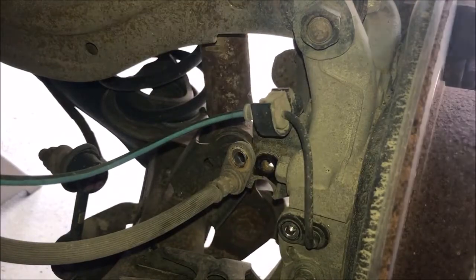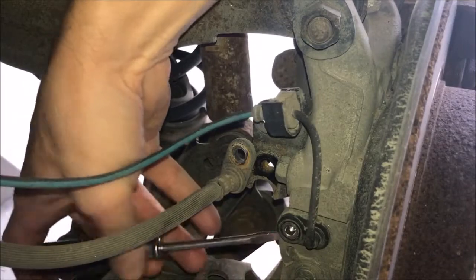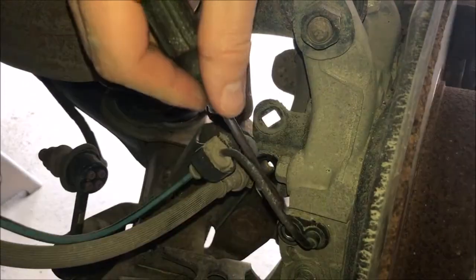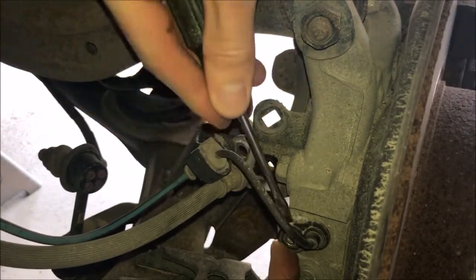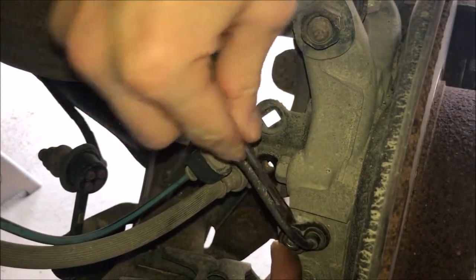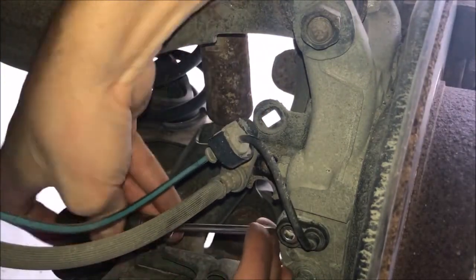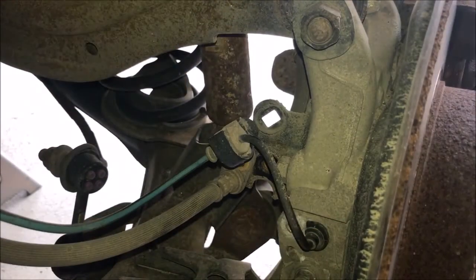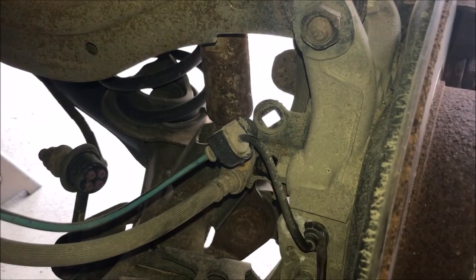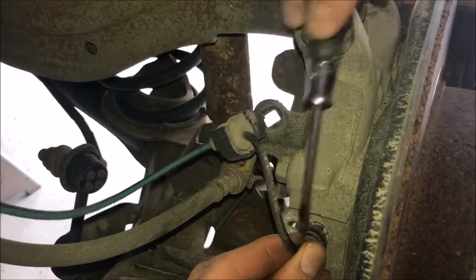These can be hard to remove sometimes and you'll see I made a mistake when trying to remove mine. If you're not able to get a screwdriver underneath, try moving the sensor back and forth, up and down, just to loosen it a little bit. As you can see, we're starting to get some movement, but I got a little impatient and applied too much pressure to the plastic tab and as a result broke it. Just take your time if it's giving you resistance. Only apply pressure to the area that houses the speed sensor. If you apply too much pressure to the side where the bolt goes, you're likely to break it as I did.